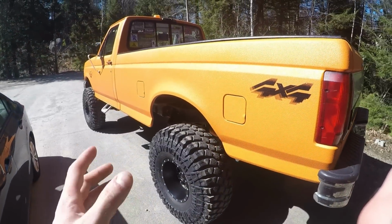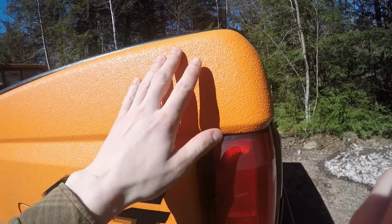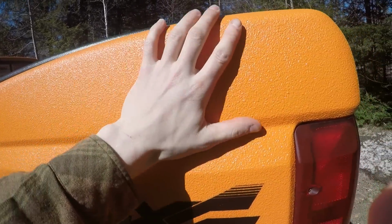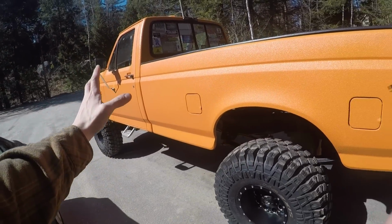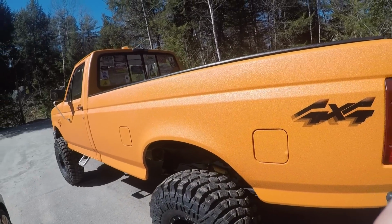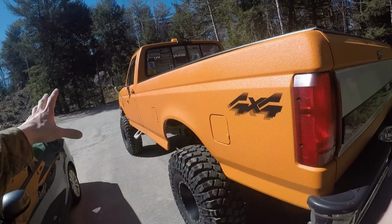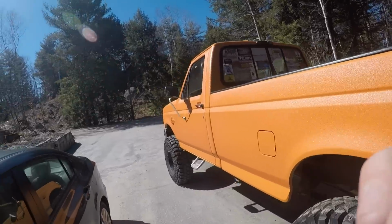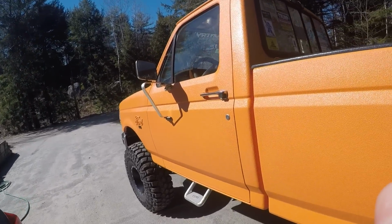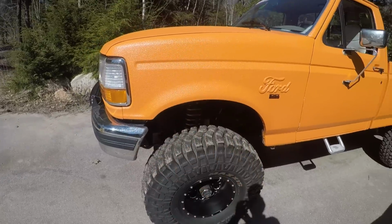The roll-on liners are usually a lot more coarse, you know what I mean? This is not smooth by any means, but it's a lot smoother than the roll-on jobs that I've seen people do, and it looks a lot flatter. You'll see roll-on jobs where you can see where the freaking roller went. In this, it's all nice and streamlined. You don't see roller marks or nothing like that. So that's why I went with a spray-on. It just gives you a much cleaner look. But yeah, reason number 1, you don't get water spots.